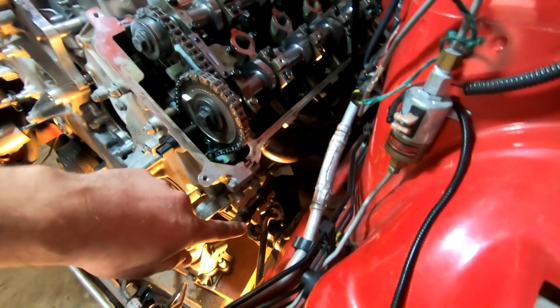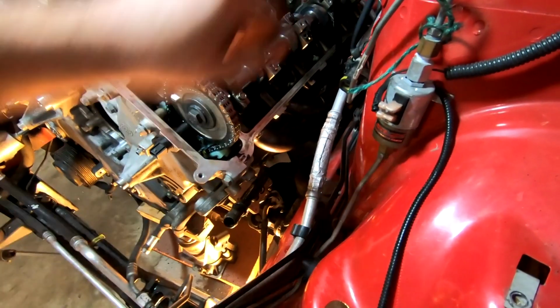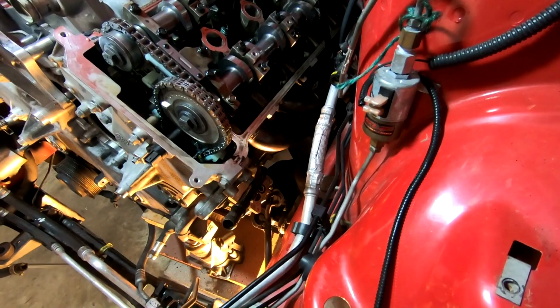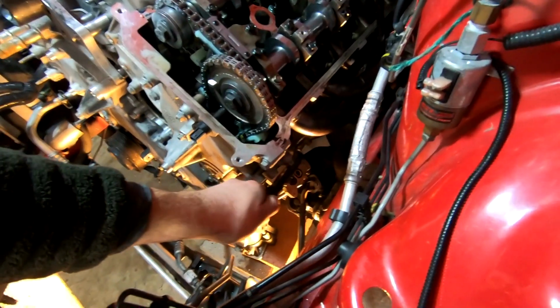All right, so I went ahead and got this tube rear bolt bolted in. I bent the bracket just a little bit, so it's a little off. I was gonna push it back and it's fine. Do yourself a favor though, and bolt the rear one of these in the back before you put the header back on, because that took a while to get it there. One of the headers blocks this bolt perfectly, so it took a while to get it in.